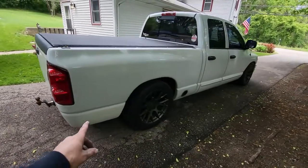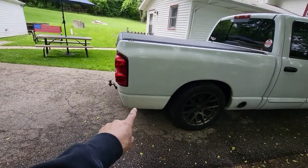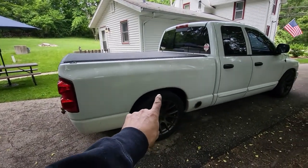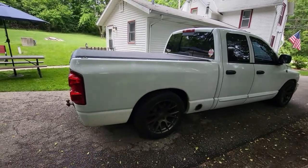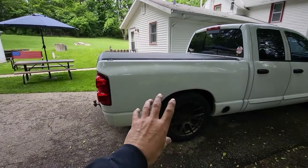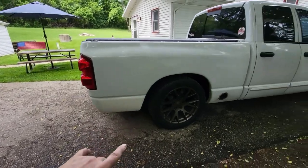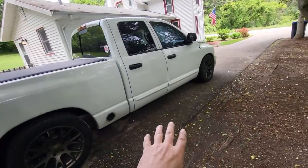This side I started working on, as you can see, the chip guard is actually a different shade of white. So once I get going fixing this side, this doesn't need a cutout. This just had some paint imperfections. So we'll get this side sanded out, smoothed out, and I'll respray it. And when I respray it body color, the chip guard will get sprayed body color, so you won't see that as much. And then below the exhaust, you can probably see I chip guarded the bottom of that. Did not address the bottom of the doors yet.